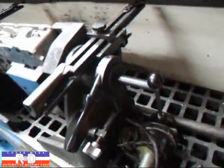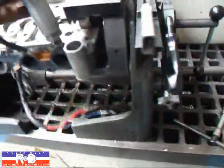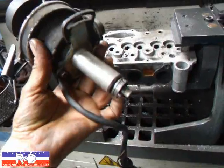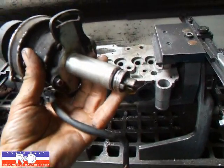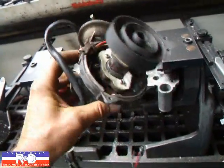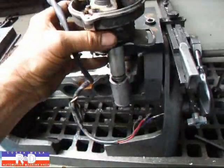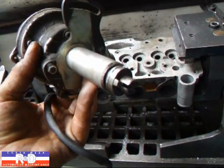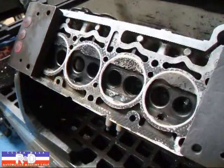All we have to do now is adapt this distributor to our Fiat. We've already been working on this — we've got a different mechanism down here for the coupling with the engine for a Volkswagen. So we're actually working on a twin plug, twin fire Volkswagen application right now. All we'll have to do is modify the hole here and the end so it hooks up with the Fiat, and we should be good to go. If you have any questions about this, give me a call.